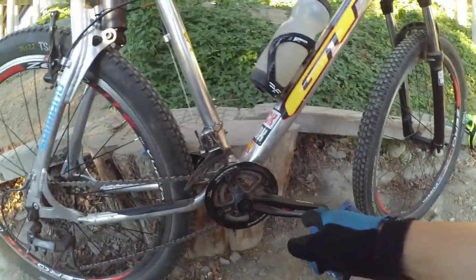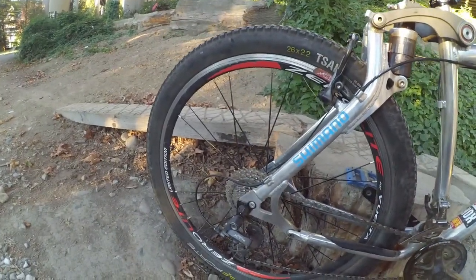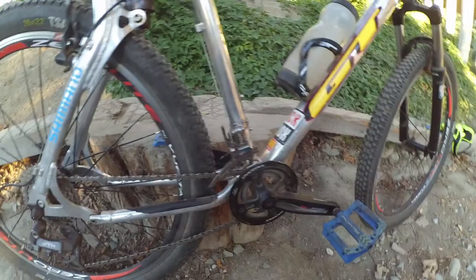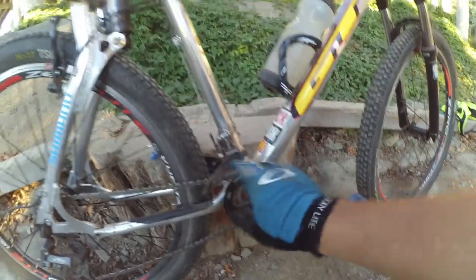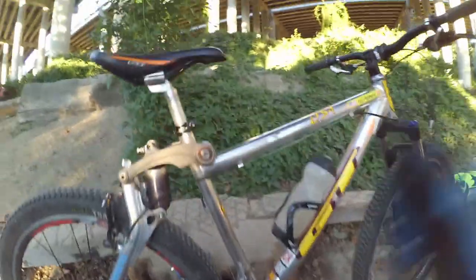For the crankset, I didn't want to go with a one-by, because my cassette is a sub-40 tooth. For climbing I just wanted to have a granny gear up front, and that's been working pretty well. This is a 32-tooth with a bash guard, and I've nicked something so it comes in handy.